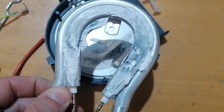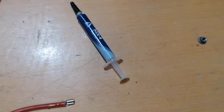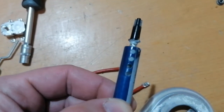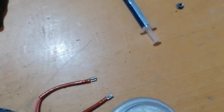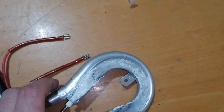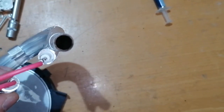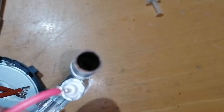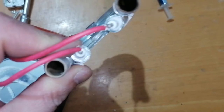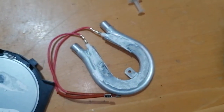So what I will do is clean this surface and apply a little bit of thermal grease - MX4. I will only use a little bit. Also we will run a cycle to clean some of the lime scale, but it's not that dirty I would say. There is a little bit of rust, but that's more from the tap water than anything else. I don't see a major problem here - I will run the lime scale remover cycle anyway as we do have some solution.